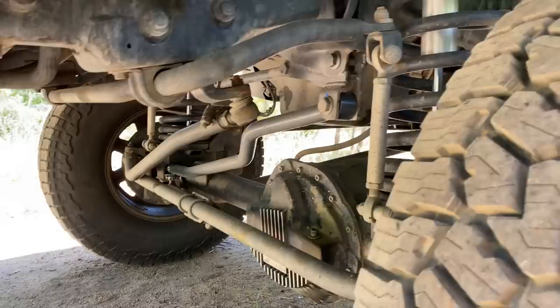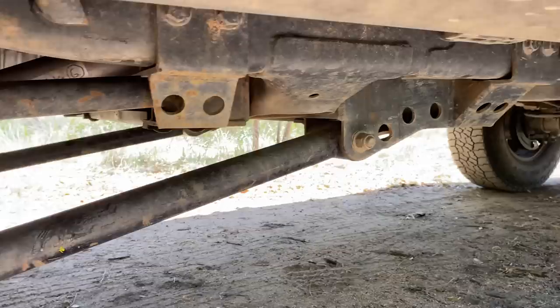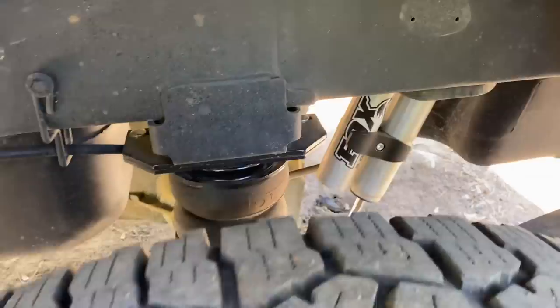I went with this kit because this kit in particular was what I was using for a Baja chase truck. I was supposed to chase some bikes, wound up not doing it, but still built it out that way, and it's been super advantageous since then. If you noticed, I've changed out some components along the way, our front drive shaft, changed out some different things on the rear end, upgraded the shocks to 2.0s in the rear end, even added airbags in this case that are Bluetooth controlled from the cab to be able to level it, so it's not all dependent on these flat leaf springs.